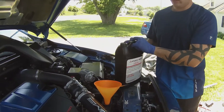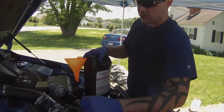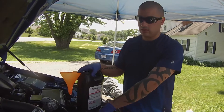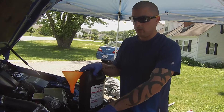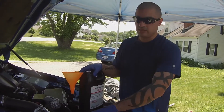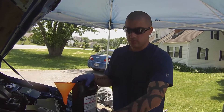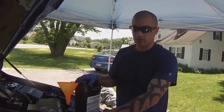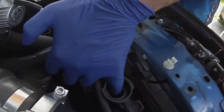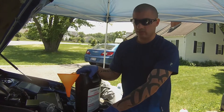Once it's completely filled up, squeeze the hoses to make sure there are no air bubbles. If you have another person it's easier, but get inside the car, turn the car on, put the heat on the highest it'll go, and wait for the coolant to start rising up in the fill neck. As soon as it starts rising up, shut the car off and immediately put the cap on. That gets all the air bubbles out of your system. Once you see it rising from the bottom, the system has pushed all the air out and is pressurizing itself. Don't fill it all the way to the top — fill it to the very bottom edge of the fill neck — then once the car is running the system will pressurize itself and you cap it off. Secure all your connections, put everything back together, and you're done.